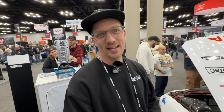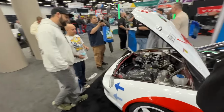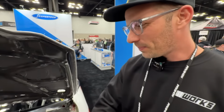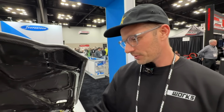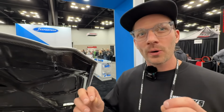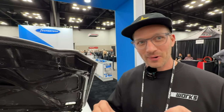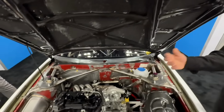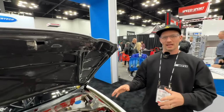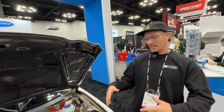I was like, what do you mean? Look at this engine. It's a 3-cylinder. This looks like a jet ski engine. I know, it's literally ridiculous. When the engine builder Randall at Precision pulled everything apart, he was just picking everything apart. There's different coatings on each piston ring and ringland, and 3 piston oil squirters on each one. It's really built to like a 2JZ spec of engine that can handle power.